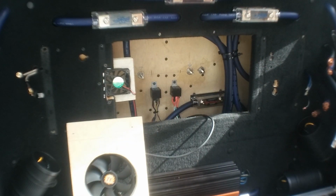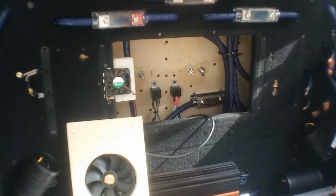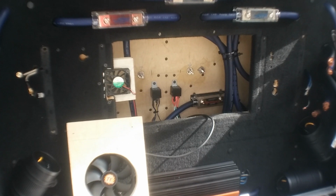So now, what I always like to do, we take these jumpers and put them somewhere safe. They won't get lost. And now what I like to do is take a multimeter and measure the ohm load on each sub and check the coils, make sure everything's all right and they're reading okay. So in case when we put them back together there ain't any further problems. So that's what I'm gonna go do now. Let me go grab my voltmeter and we'll check everything.